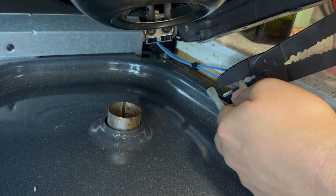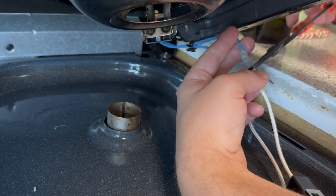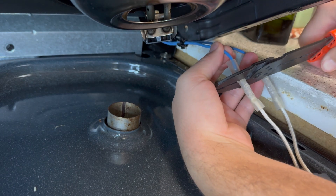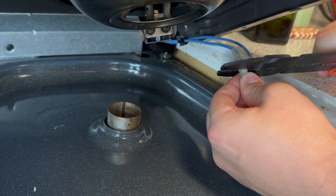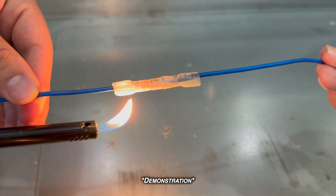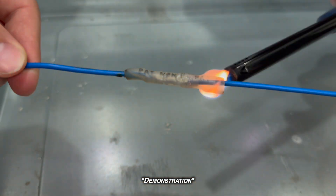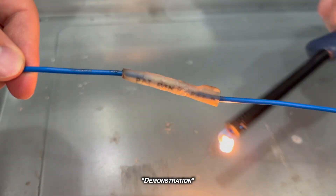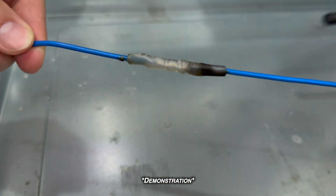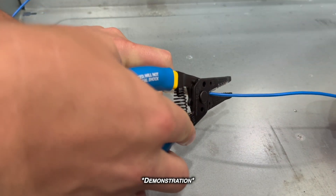Now I can make the crimps to the stove. Both of the lines coming out of the stove are hot, so the order does not matter and they can be connected on either side. A long wire replacement kit is also an option and is typically better to use if the wires to the receptacle block are damaged; however, the process to install this kit is a little more involved, as you need to pull the stove away from the wall and access the back to unhook the wires from the control switch. The splices I used also have heat shrink on the ends, which can be shrunk using a lighter; however, you must be careful not to burn the wires or splice — a heat gun or hair dryer could also work. One downside of using splices is that if you have to replace the terminal block again, you will have to cut the wire, which may make the wire from the stove too short depending on the replacement kit.